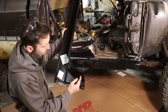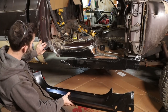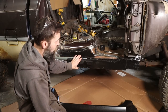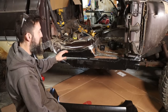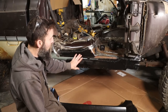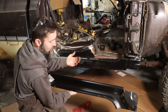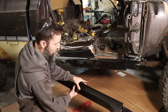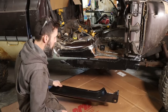I've got my rocker all marked out and I'm going to cut it just above that line to give me a little extra metal, then come back with a hand sander to make a really nice butt joint so this rocker lines up exactly where I want it. Now, a lot of people won't replace the inner rocker — sometimes it's rotted so bad they didn't even know it was such a thing. But I suggest that if you do one of these, put the inner rocker in because it adds a lot of stability — it caps the back and turns this into more of a tube than just thin sheet metal. If you jack under here and the inner rocker's not in there boxing it in, it'll just crush.